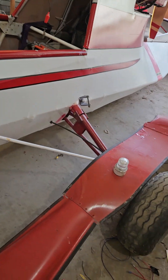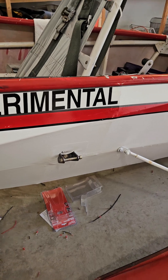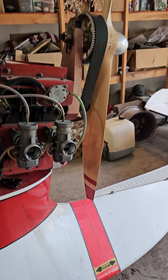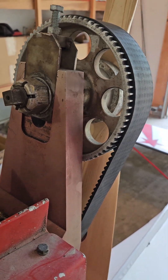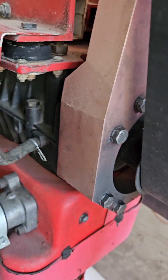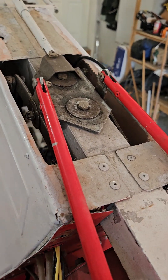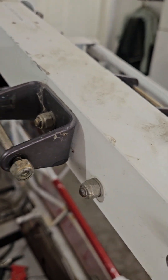Maybe we can work together on it. I know you said that needs to be turned correctly — I'm going to change that up. Here's all the connections up top. I did get some cotter pins for this thing. There are the bolts and stuff, and then there's your controls up top for your ailerons — a little dirty. I'm going to wash everything once I get everything hooked back up; everything seems to be okay to me.